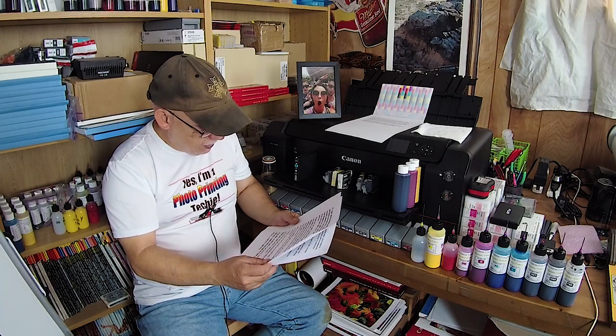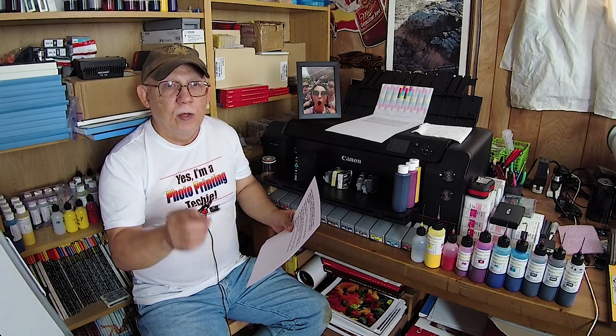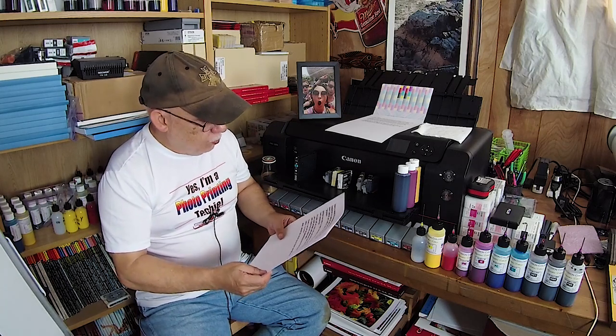So you want to be extra, extra careful. How do you avoid that? You might say, well, just be careful — but all of us, at some point down the road, will make that same mistake. I've made that mistake, and luckily it was on a printer where I could immediately fix the problem by just switching the cartridges with correctly filled ones. One cleaning cycle done, then I flush the other one at my leisure and make sure I fill it with the correct colors next time.